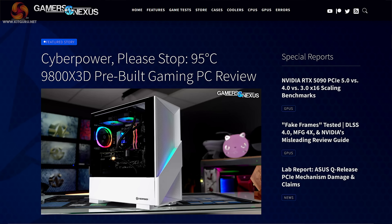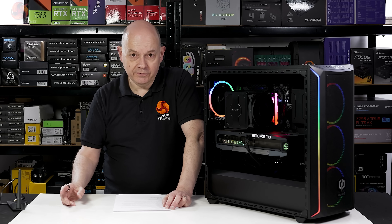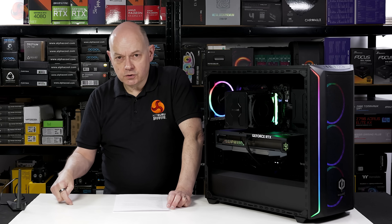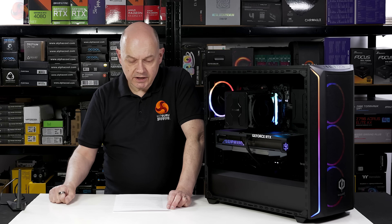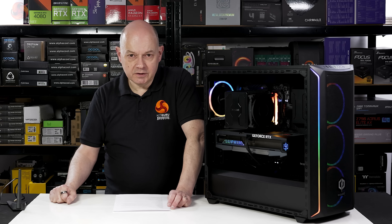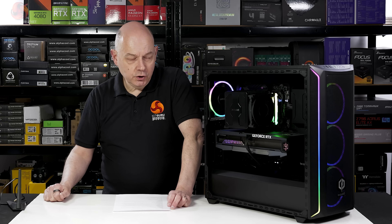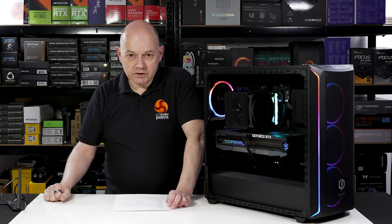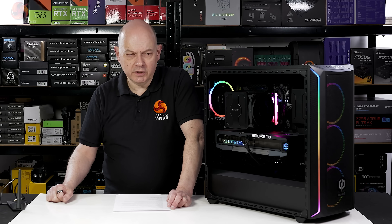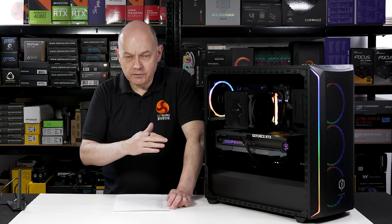It's worth noting that Gamers Nexus reviewed a CyberPower PC they bought and were quite unhappy about the thermals — and that PC used the same processor as this one. However, CyberPower UK is quite a separate entity from CyberPower USA, and the Gamers Nexus PC had an enclosed case with very little mesh airflow and an AIO that appeared to be starved of air. This Be Quiet case is huge, flows air like a champ, and has loads of cooling — it's good. Personally I use PBO to limit thermals on my own AMD Zen 4 system and don't like processors running over 95°C, but this system is absolutely fine from a thermals standpoint.